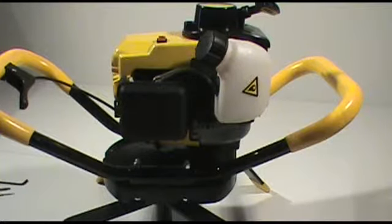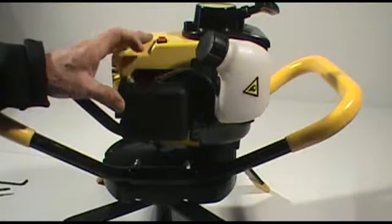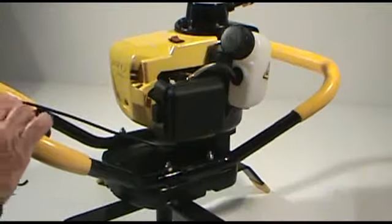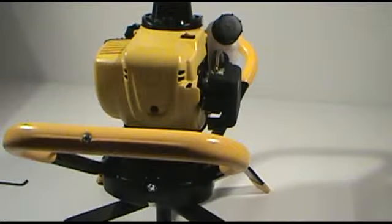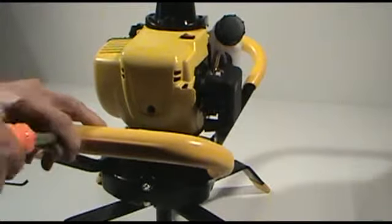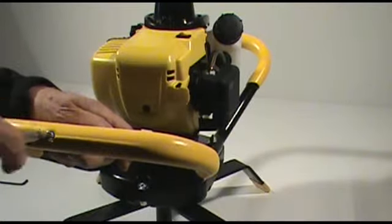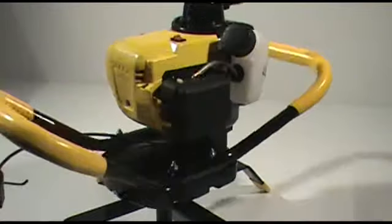In this segment, we're going to cover the proper procedure for changing out the carburetor on the Jiffy Model 4G Lite engine. The first thing that we're going to want to do is remove the throttle lever from the control handle. Get it out using a Phillips screwdriver. Just going to go ahead and back that screw out until the handle comes loose. Set that to the side.